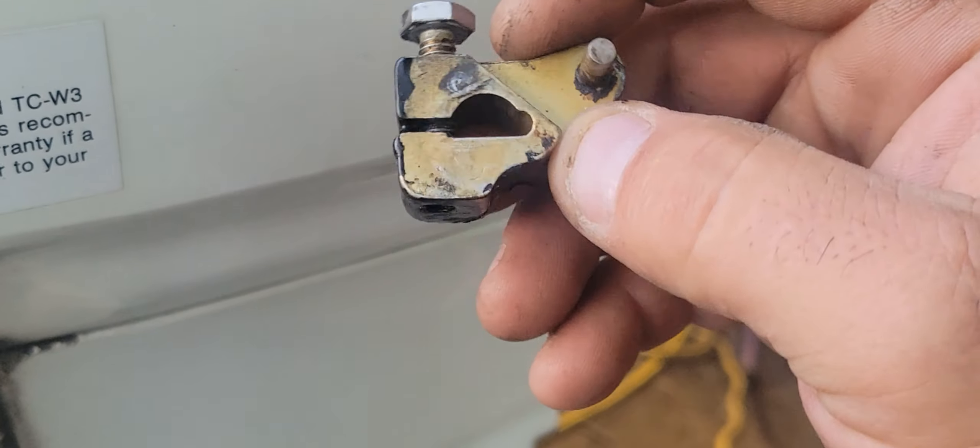You've got the two rods — the one I showed you earlier and then the shift shaft. You can see that moving there — that's the shift shaft that I'm moving on the other side of the engine. You have to line up the hole in it — you can see the hole there — the hole in the shaft next to it, which is the white one that was on the lower unit. You have to line those two holes up, and right there in the center of the frame, that's the shaft that you have to get that little guy over.